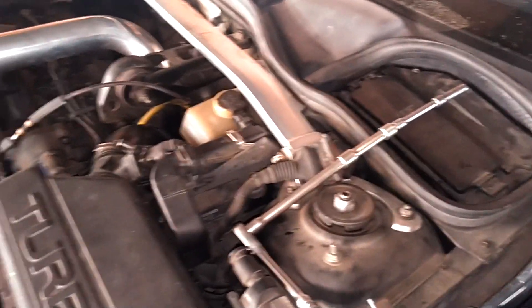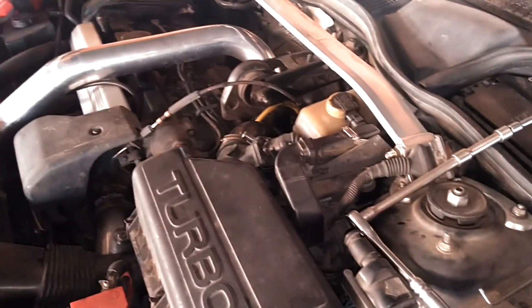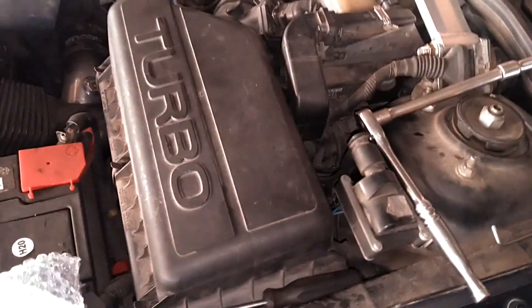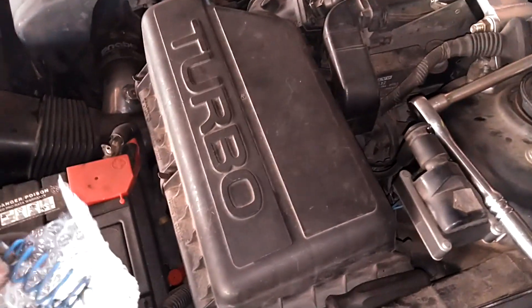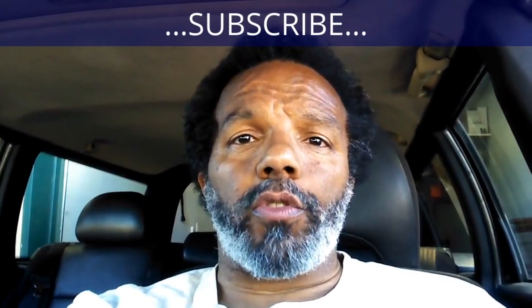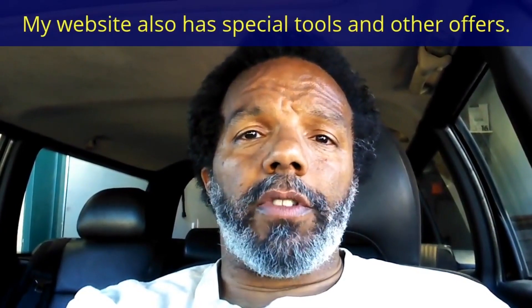I'm all done with that. Hopefully that spring will give me the pressure I need to get the boost I want — I really want 17 to 18 pounds of boost. That's going to be plenty with this turbo I got. I have a few extra springs here. The next one after the yellow is the blue, so if the yellow doesn't work I'll put the blue one on. If you feel this information was useful, please like it and share it with your social media friends. Subscribe to my channel for future video notifications. You can follow me on Twitter, and if you need to contact me directly, please visit my website. If you have any questions, leave them below and someone or myself will reply. Thank you very much for watching.